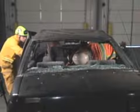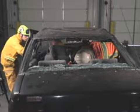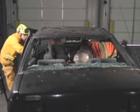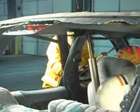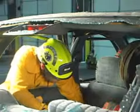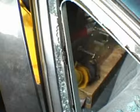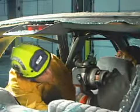Besides using the cross ramming technique to reproportion the vehicle because of damage, consider a scenario where this vehicle is a brand new Volvo XC60, where all the roof posts are filled with boron steel reinforcements and your hydraulic cutter couldn't cut the roof post. We can use the ram and the cross ramming technique — cross ramming vertically — by stretching the roof upwards to remove the patient out of the back of the vehicle, a kind of vertical pick coming through the rear window opening, because we're going to stretch it vertically. You can see the crew is setting up the ram to do this.